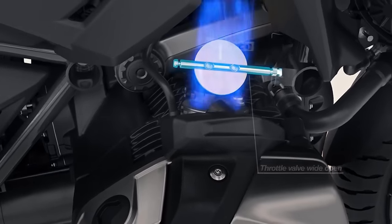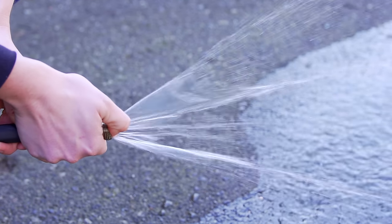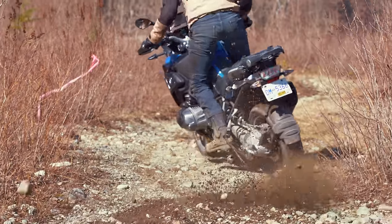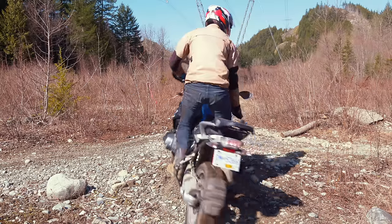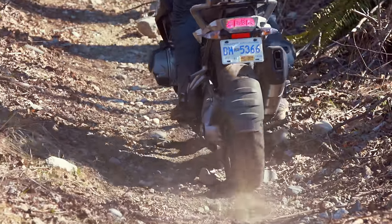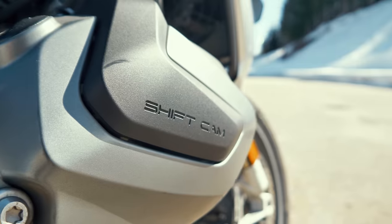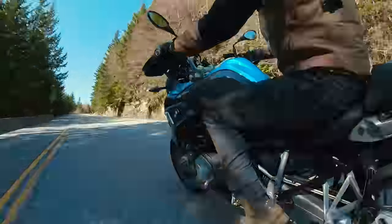Of course we want the intake wide open when the engine is pumping full revs. But when the engine turns slow, narrow valve lift actually increases port velocity, funneling more turbulent air at low revs, giving a fuller burn. Hardy torque — 14% more hitting lower than ever. Like an 800-pound badminton player, this behemoth changes direction at the flick of a wrist and floats up hills even at safe, near idle speeds. All thanks to variable valve lift, and all on a machine that still flies home at the end of the day thanks to variable valve timing and duration.